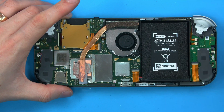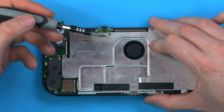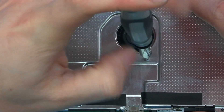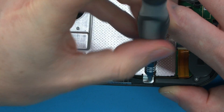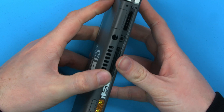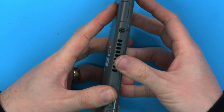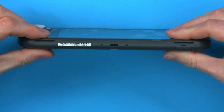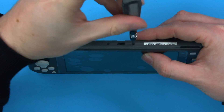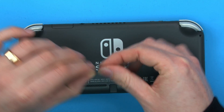The console is now powered up. Let's put the back cover on first. We have the metal back plate that sits over — it had one long gold screw on the left when we disassembled it, and the other screws are small silver screws: one down at the bottom by the speaker, and the final one up by the card reader. Place the back cover on, making sure the circle of the headphone socket aligns over the headphone connector, and click the back cover into place. We have the final four Phillips screws on the thin edge, and the final four screws are the longer tri-wing screws, which are the only tri-wings on the Switch Light.